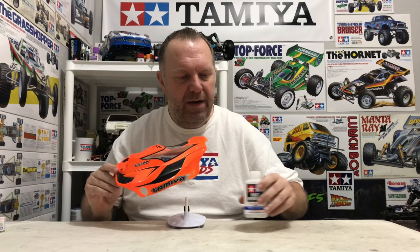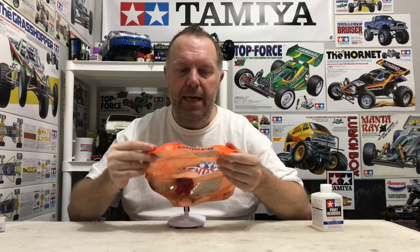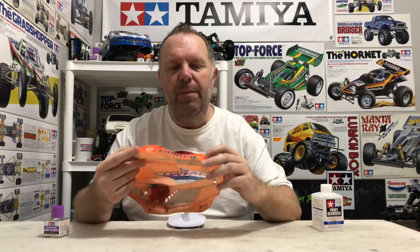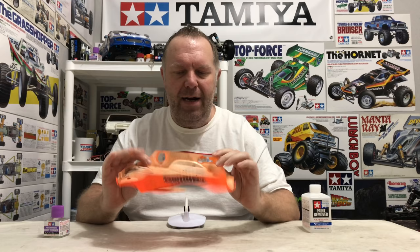Just before I bring the camera over — before I started this video I wanted to make sure we could get some of this paint off. So I got a little cloth and I started with the polycarbonate cleaner, just to see if the paint would come off — and that took some paint off. Then when I got the paint remover the other day, I did a test section as well. So I've got two sections where I know both products will work. You can't tell about clouding or anything just yet, but pressing it — it doesn't feel any weaker, there are no cracks. That was done over 48 hours ago.